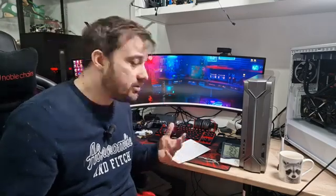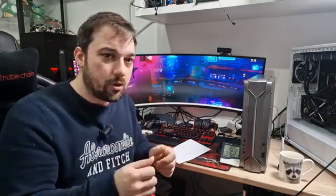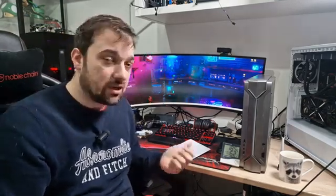It did really well — it's not groundbreaking and it hasn't blown me away, but it's good. Although it's not really more difficult to install, you just have to be a bit more careful not to break it when putting it on. But it's a lot less messy — you literally get a little sheet and put it on without getting it near your fingers, whereas thermal paste can get everywhere. If you're looking for a thermal interface material and you're sick of using thermal paste, I'd definitely recommend this. MX6 is a great paste, so if it's on par with that I can't complain at all.